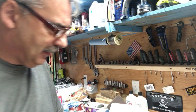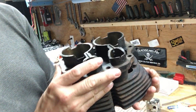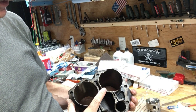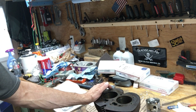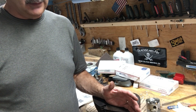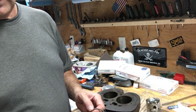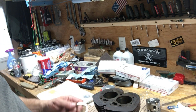It's been a while since I did a video. Got this cylinder and you can see it's being resleeved. When I bought it online, the guy didn't show any pictures of the bottom of the cylinder and I was leery of that. Instead of standard bore and standard pistons, I never thought the guy would have resleeved it, but it's resleeved — it looks like it's gonna be okay. I'll just check the piston ring end gap. I didn't get to show any of this from when I tore the bike down three years ago and I didn't do any videos back then. So we're gonna pull the top end off this bike.